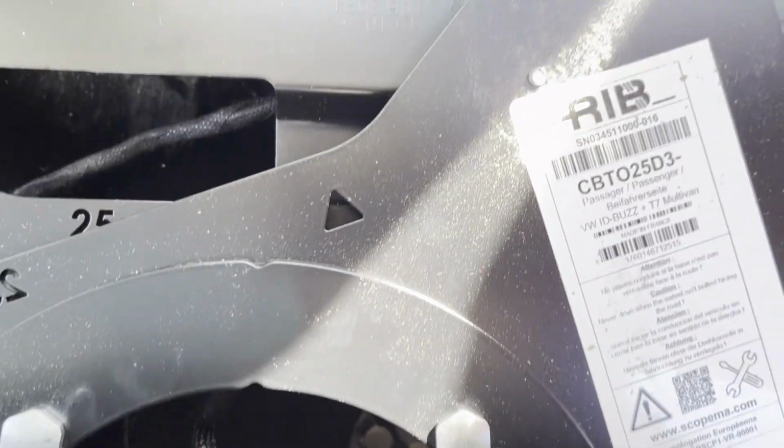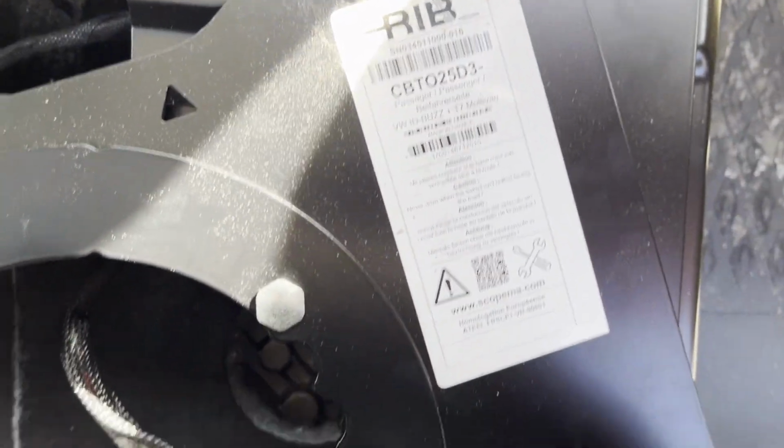All right, so I positioned the seat back in the vehicle after the pins were cut. And then I'm reaching down and by feel actually connecting the airbag on the left, relatively speaking, left from this view, and the power connector on the right.